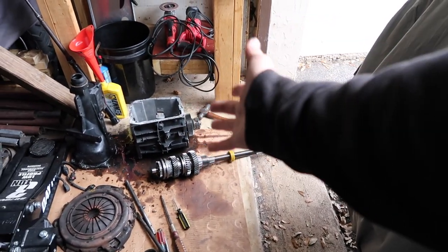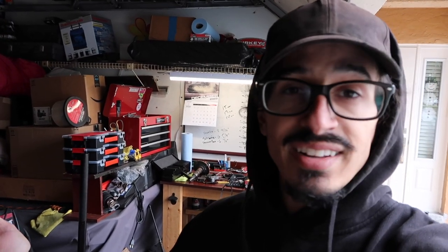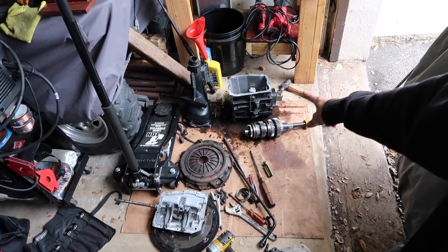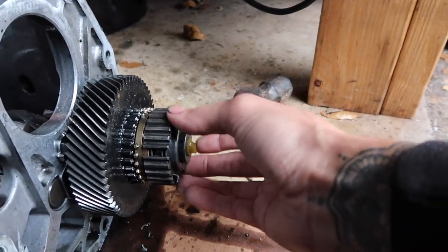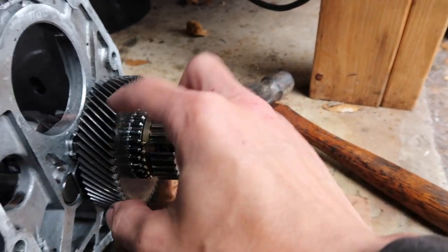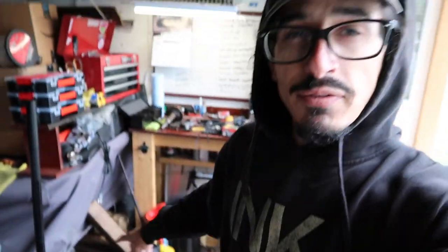That's all I got for you today. I got some research to do — I have to figure out exactly what those two gears are and see if I can source them and if it would be cost effective to rebuild this transmission on a budget and get it back together so we can slap it back into Miss Parker and get her back on the road while we're saving up for a TKX. Hope you enjoyed the video — it was pretty wild. We popped the T5 out of there, broke her down, and saw exactly how badly we damaged her — pretty bad. Also if you guys know how to remove fifth gear, because me just trying to pry it off the way everyone online showed didn't work for me — drop a comment if you know. Be easy!